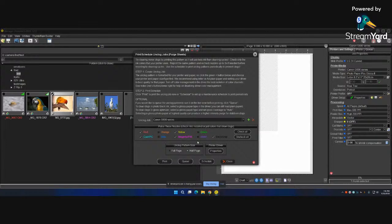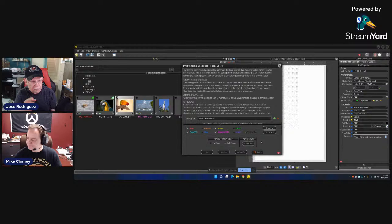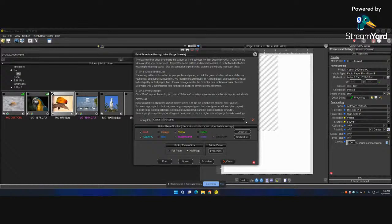And that printer you have set up for is dye-based, right? So right. You don't have to worry about matte black and photo black. That's for pigment printers. I don't really want to get into that. But just give us a very basic setup. I'll just mention, if you're working with a printer that does have matte black ink and you know that matte black won't print if you select glossy photo paper, correct. All you would do is click this plus and create a second job and choose matte paper so that that one will use the matte ink. So you basically need two jobs. So each job triggers a different black ink.